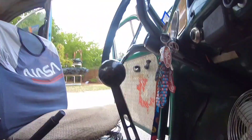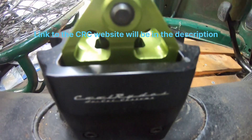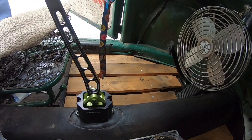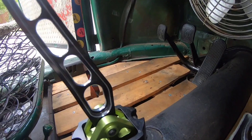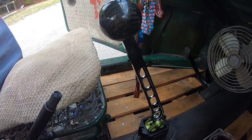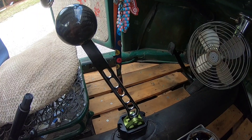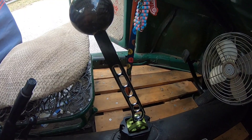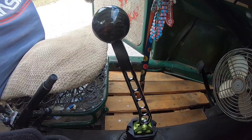The thing that I did is this shifter. A company called Cool Rides SoCal Customs — they make these super awesome short throw shifters and you can customize them. I got the carbon ball shift knob and it has a green little base to sort of match the green on the car. It doesn't have a reverse lockout, so the normal VW stock shifters have a lockout but this one doesn't. At first it did take a little getting used to, because sometimes going from first to second I accidentally pull it over to reverse — you'll hear the grinding. But once you're used to it, and I've been driving with it for about two and a half, almost three months now, I'm pretty happy with it.